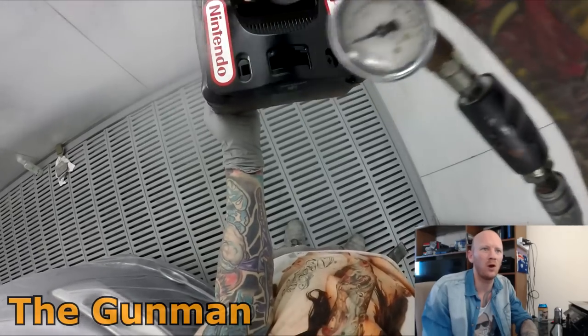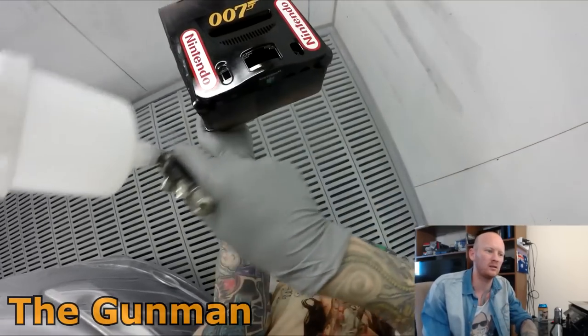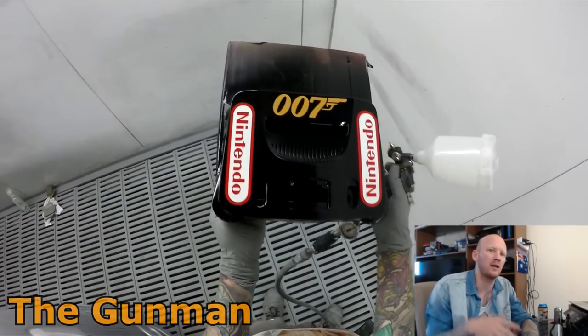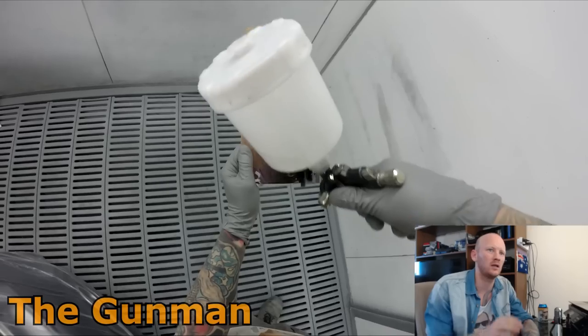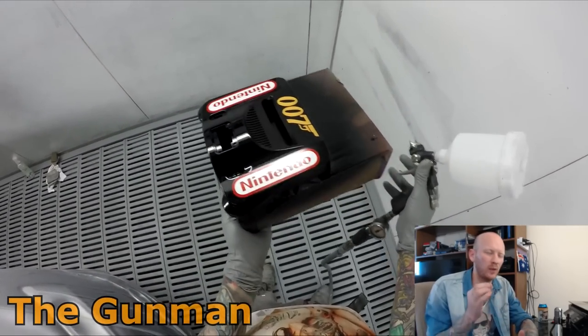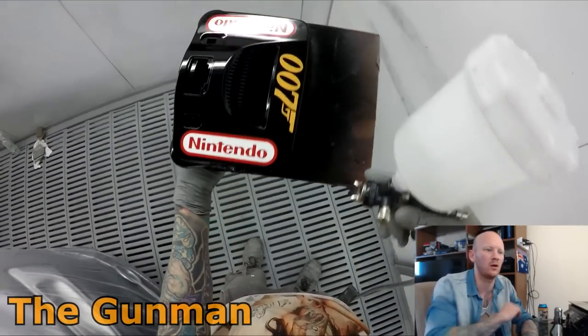When you're doing automotive refinishing, a little bit of a yellow tinge isn't the biggest deal. It can be sometimes on the lighter colors when you're doing a blend, because even one coat of clear can be enough to change that color, but especially when you're doing custom work, you really want a clear clear.